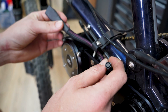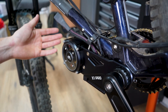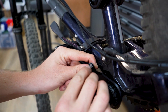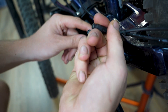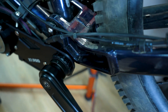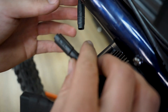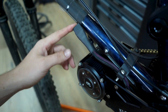We've installed the hanger now and we're going to connect up all the wires. Usually we have a battery sitting on the belly of the bike — one of our B-Series batteries that we flipped. We're exploring different mounting options to get the center of weight down and clear up space on top. This is our Bluetooth and speed sensor — you can identify it by the two notches, so you can't accidentally plug it into a hall or torque sensor cable. It's a dedicated cable for Bluetooth and speed sensing. The Bluetooth sensor is already installed at the back with the magnet. Then our 12-4 harness — we have a shift sensor on this one, already wired up, so we'll plug that in. Then we'll put the battery on the belly and plug in. Done.